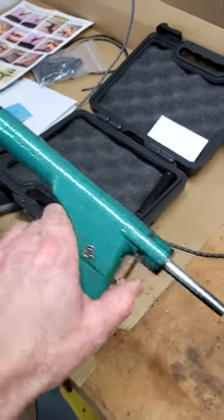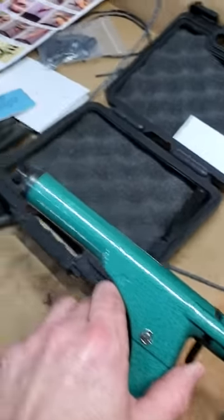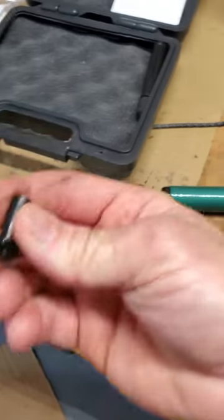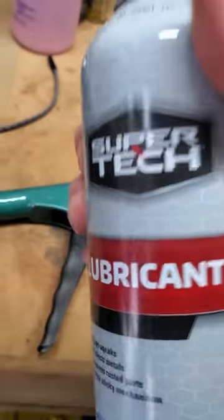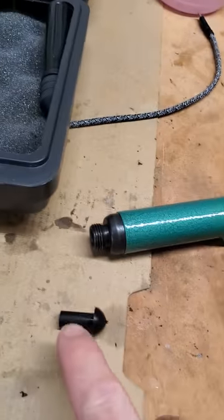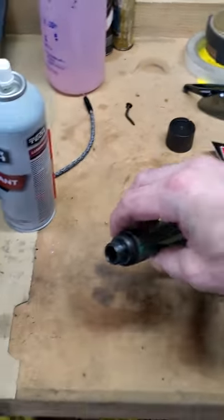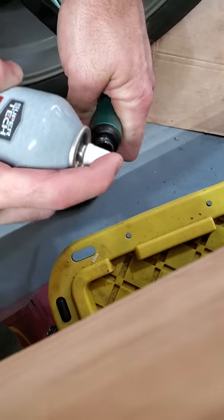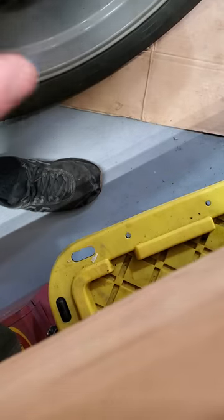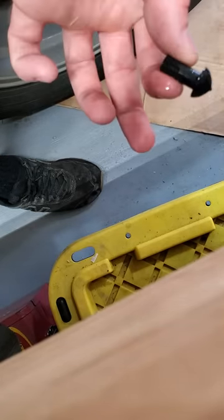While I've got the hole plugged, grab your gun and release it with this button — it forces the plunger out, it's spring-loaded. One thing that's super important: you want to lubricate — this is super important — lubricate this mushroom and the inside of the nozzle. Spray it in there so it'll help it go into the tire easier.